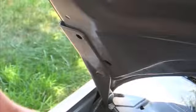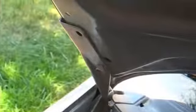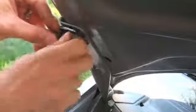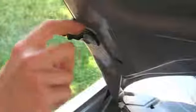Then we lay this down. You get two brackets and they have a sticker on the back. The driver side is labeled with a D, the passenger side is labeled with a P. We're going to take the passenger side for this. So you have the bracket, take the bolt, put it through the bracket, find your hole, find the thread with your fingers first, get it snug. Take the bracket and align it with your hood bracket in parallel so it's nice and flat. You don't want it to lay like this or like that — make sure it's nice and flat before you tighten it.